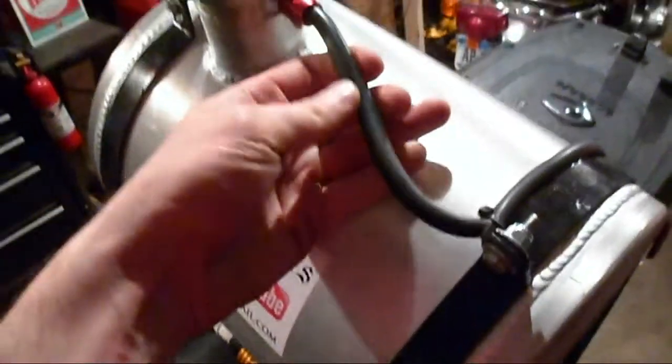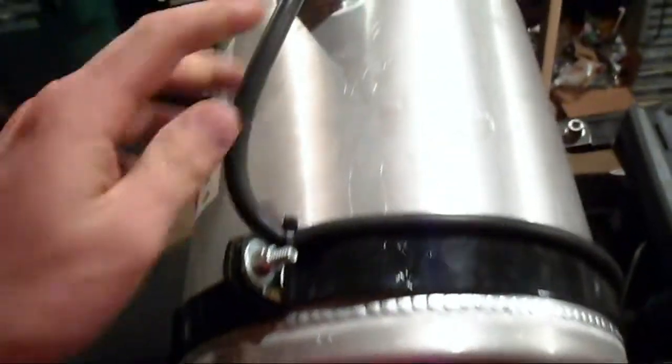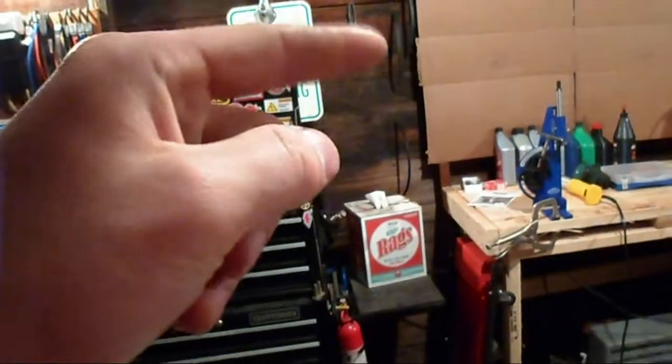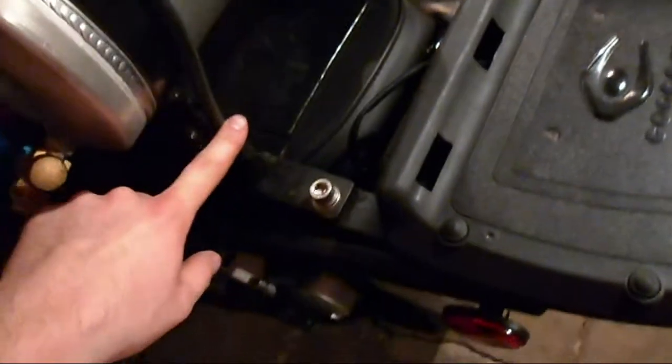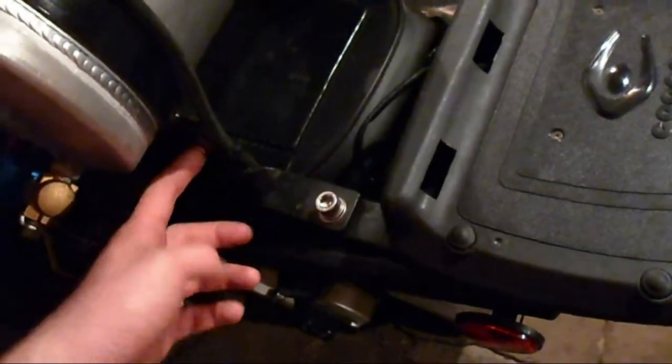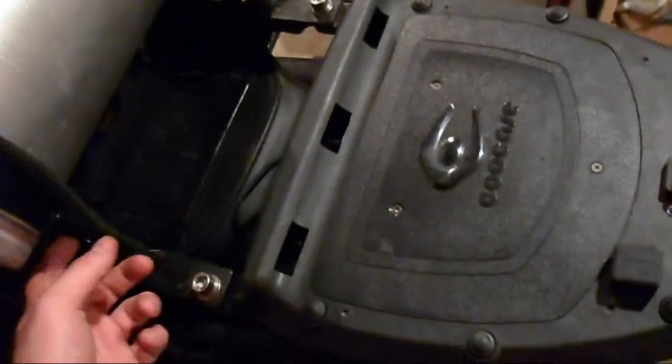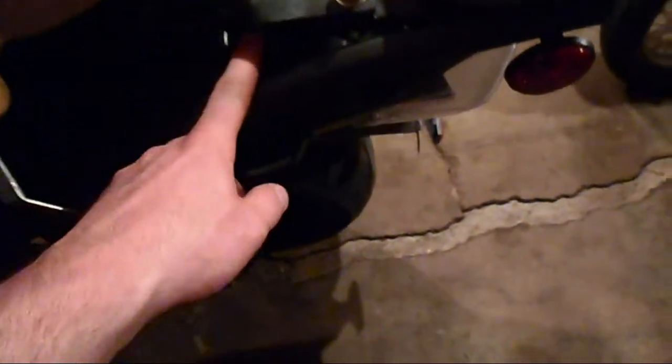For the overflow tank I have got some fuel rated line here. It is 730 series so it fits on here really tightly — it was almost impossible to get on that quarter inch hose barb down there but it fits a little tighter, which is what I wanted. It is a little more flexible than the regular quarter inch hose. That comes over to here — I have got it zip tied. It goes down along this bracket, zip tied to one of the holes I put in here for a tie down point in case I want to go camping. Then it goes underneath the bracket and lays in here right between the grab handle and the seat, and then it comes down to my puke tank.